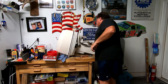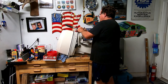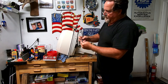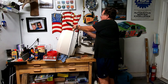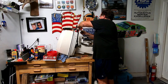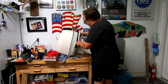I've already loosened those. Take the shift handle nut out — it has a washer on the outside and a wave tension washer on the inside. I'll put them right back in so I don't lose any of that. Remove the control handle. There's a couple teflon washers on each side of that, I'll just leave them on there. In theory this whole piece should just come right out.